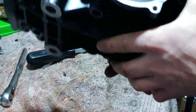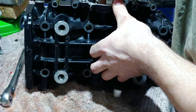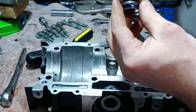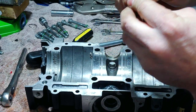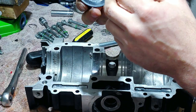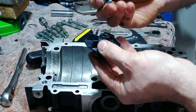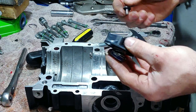Just like that. There's a bearing down in there — that bearing feels good. Just want to make sure it's twisting good. Yep, that one feels good. So that's it — that's your mechanical seal right there. The shaft goes through there. There's a rubber cylinder that goes all the way around that's flexible, and then obviously the spring puts tension on this race here, which pushes on the back of it and seals it. Then the shaft comes up through here and you seal any water leaking with this washer.